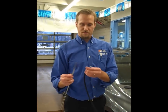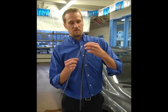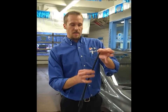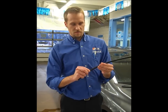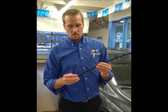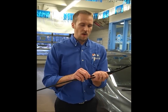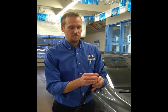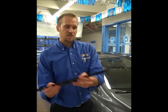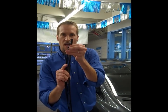Reinstallation is the reverse order of removal. Reinstall the metal strips and guide them down into the wiper insert. Once you have those set in place, feed the wiper insert back into the frame of the wiper blade. Once it's through the last catch at the end of the blade, pull down and lock it in place.